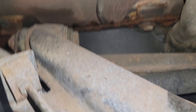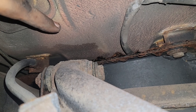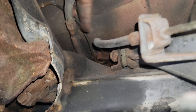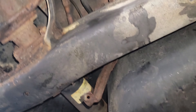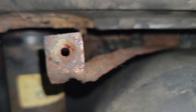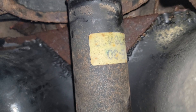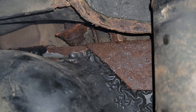If you look in that little cross, you can actually see the wetness all over here. So these lines that go to it — there's a joint junction — all these brake lines, this brake line going in there, there's a leak between that and the tank right around here. If you look closely, you can see the wrinkled paint; that's because the brake fluid has gotten in contact with the paint off the tank, and it's leaking pretty much right where that tank starts.